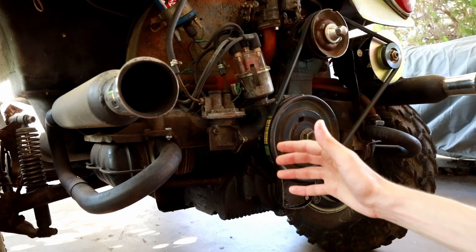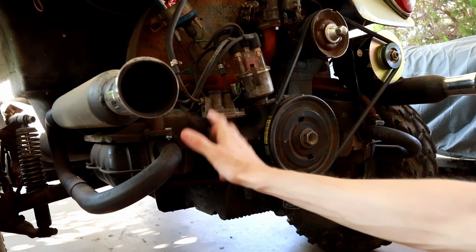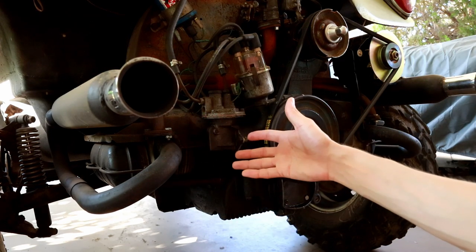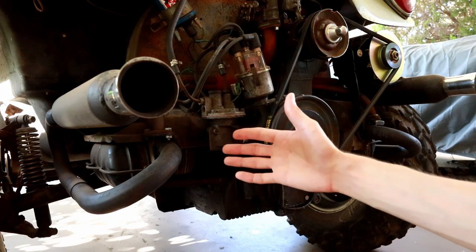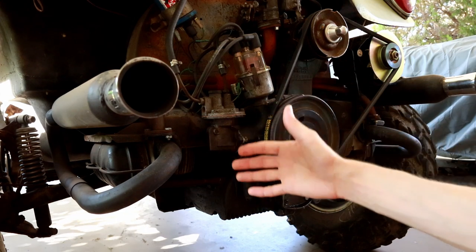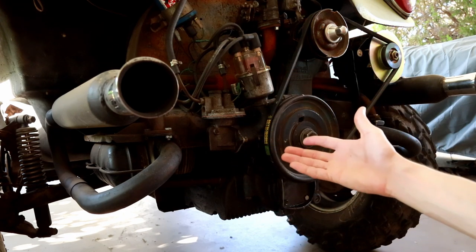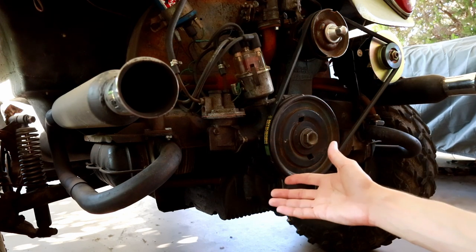Well, what ended up happening was the cylinder number 3 started burning a tremendously bad amount of oil, just huge amounts of oil smoke coming out of it, and I ended up actually unplugging the spark plug from it altogether to prevent it from generating huge amounts of pollution. That actually worked reasonably well. It stopped smoking and it remained quite drivable on 3 cylinders, but of course it was really rough and wasn't giving a lot of power. But the important thing was it kept going and going and going, and it lasted a really long time, nothing broke, and I realized this might actually be a drivable, at least backup engine, if not a main engine for driving around.